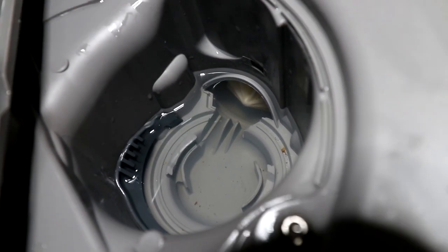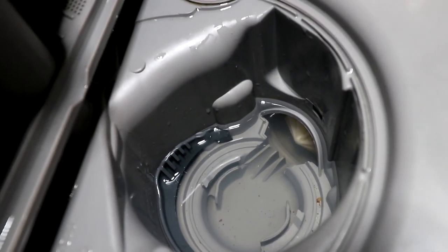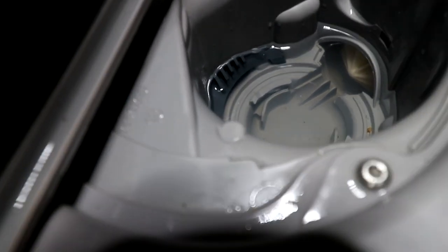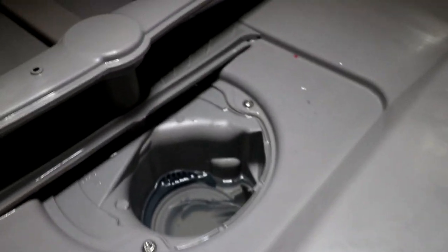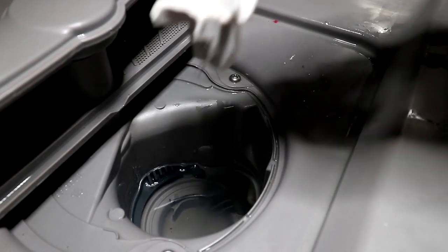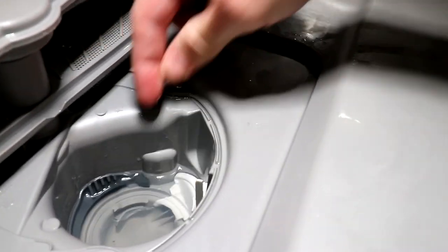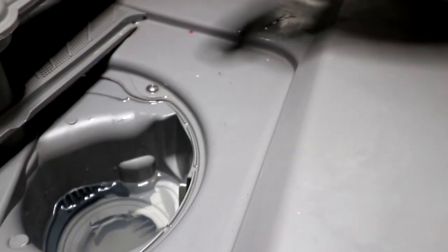It was making a real weird noise — I think it was just blocked water. What I was hearing was a pressure build-up on that impeller, which caused all the issues. Replacement is just the reverse — it goes in like that, push it down inside, then push it back until it clicks, and that's good.